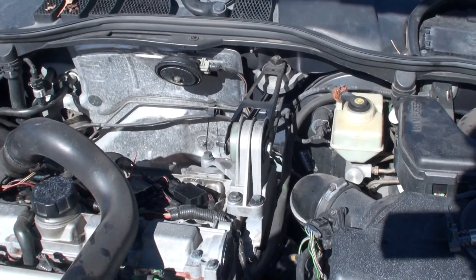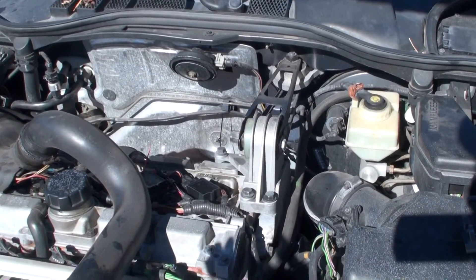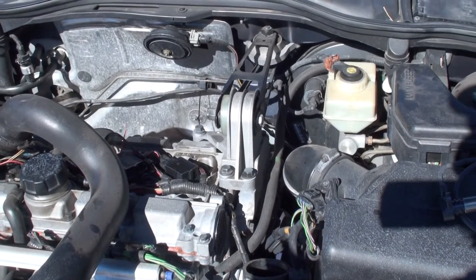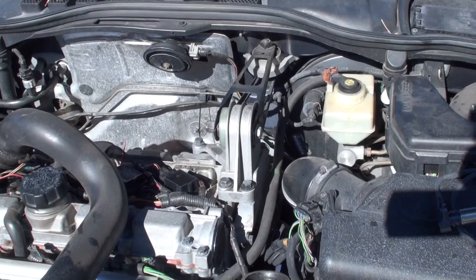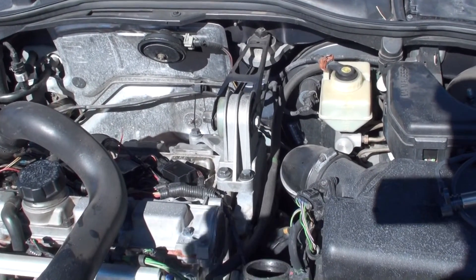It's been doing a straight-up cut off — it turns over like it's fine sometimes at start, then it shuts right back off. It's not reading from the cam sensor and it's killing the motor, making it just not run right. It's not getting the signal it needs to tell where the cams are.